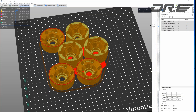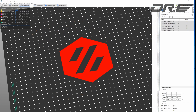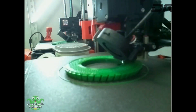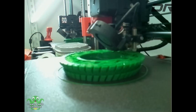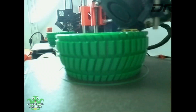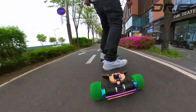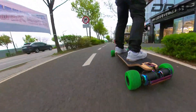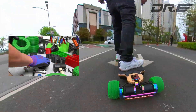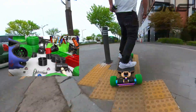You can buy our Dr. ETP wheels 3D print kit, which includes STL files for the wheel hubs that you can print in either PETG or ABS — we recommend ABS, but PETG has worked fine for us. It also includes STL files for the left and right wheels. They are directional wheels, and we recommend using 95A TPU, which you can pick up easily on amazon.com for about $20 per kilo. You'll also need M5 nylon nuts and M5 x 45mm screws to fully assemble the wheels. We've uploaded a full step-by-step video tutorial on how to assemble your TPU wheels and install them on an electric skateboard.